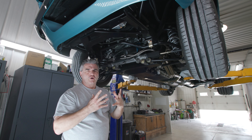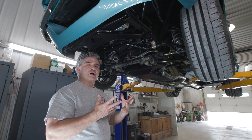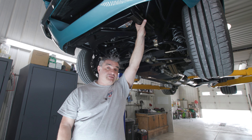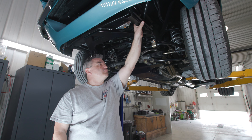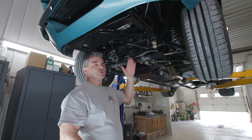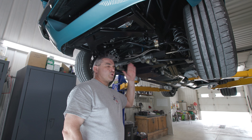First off, it all starts with a firm foundation. This particular car has our long frame in it. The interesting thing about our long frame is that it's made of 2x3 box steel, as opposed to the stamped steel that came from Ford back in the mid-60s. So it's definitely more accommodative to the high horsepower engines that we're seeing more prevalent today.